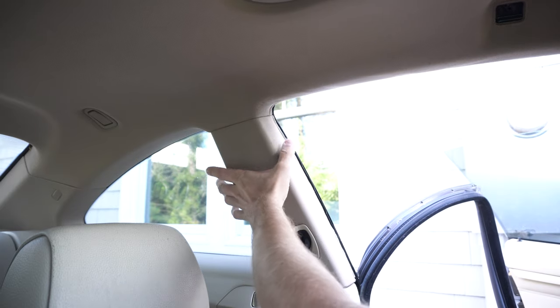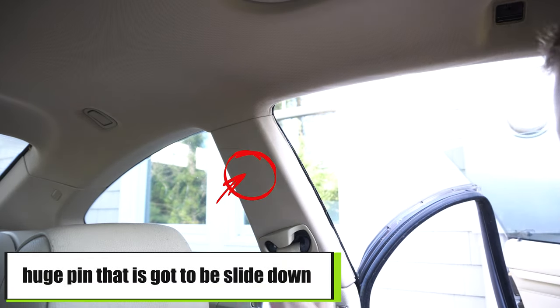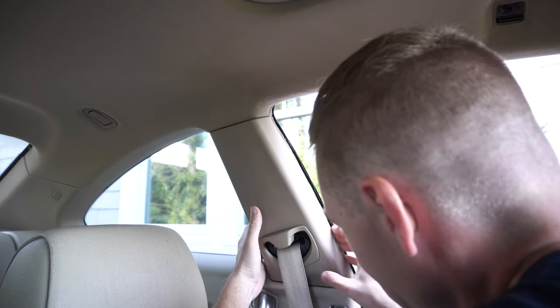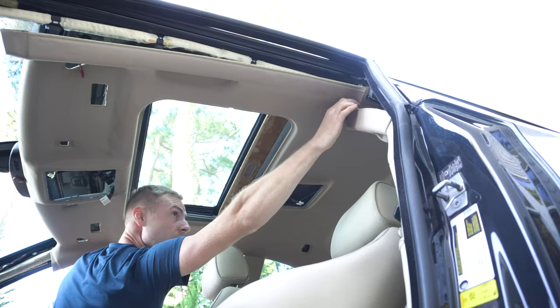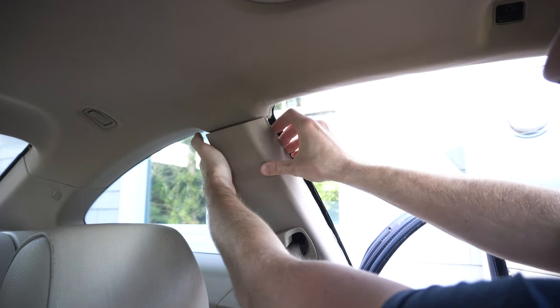B-pillar, that is a little headache. To remove it completely, you need to also remove the bottom portion or bottom trim. Check the video in the description below or the cards here. Worth mentioning, you don't need to remove the driver's side at all. Just have an extra pair of hands to drop the liner, and with a little squeezing, you can remove the headliner without removing the B-pillar.